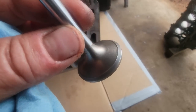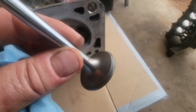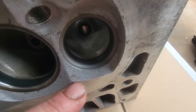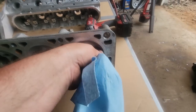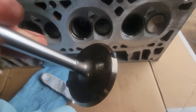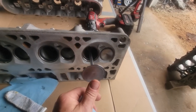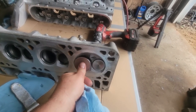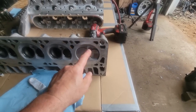Put a little valve grinding compound on the first one. You see how it's perfectly centered on that valve and you can see how nicely it is in that seat. So I'm going to continue to do that just like this — a little valve grinding compound, 180 out from each other. Push it in, and then use a cordless — I'm going to spin it a little bit.